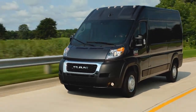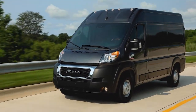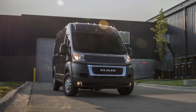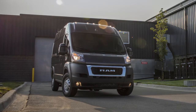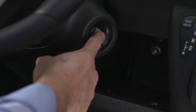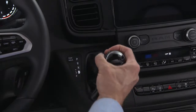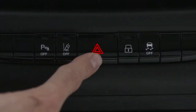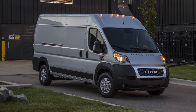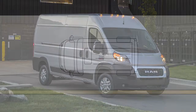Here's hoping you'll never have to, but just in case, let's talk about changing a flat tire. Make sure you're parked on a firm, level surface safely away from traffic. Avoid ice or slippery areas. Also make sure the ignition is off, put the vehicle in park, turn the hazard lights on, and firmly set the parking brake. Blocking both the front and rear of the tire diagonally opposite of the jacking position is also a good idea.